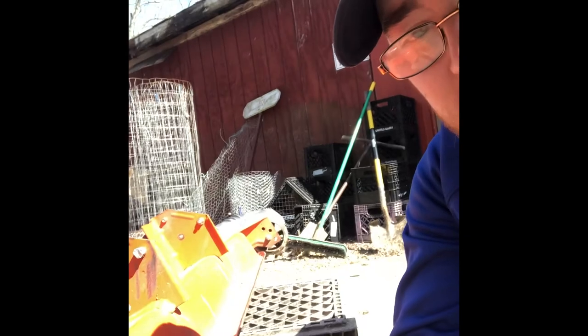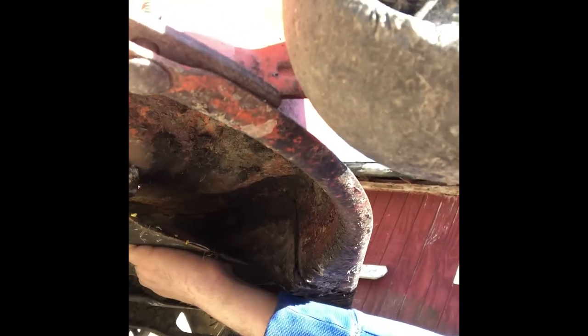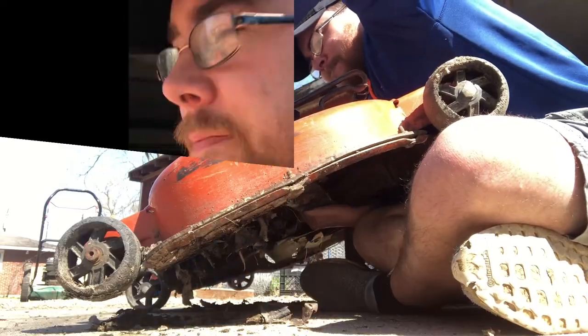but I'm just getting started, so I always try the build-the-muscles way first. I got an adjustable wrench, and what you're gonna do is put the wrench on the top, and then reach under the deck, because everything's disconnected, and hold on to the blade down there, not hard, just put some tension on it. That way when you go to loosen it, you can use strength from both arms. Wrench one way, and then opposite on the bottom where the blade is, and you can crack that loose and take it off there. So that's that.